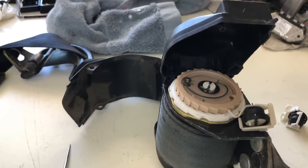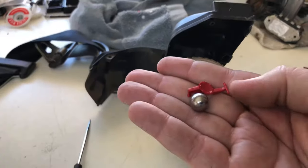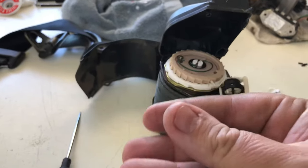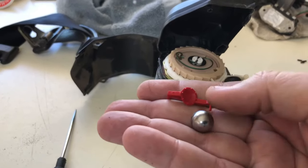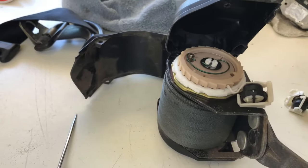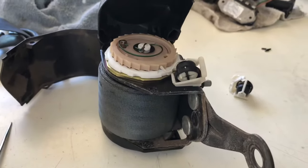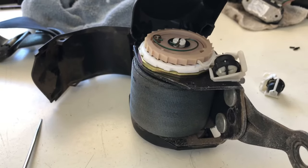The designs of these things differ from belt to belt. Here's a different one taken from a front seat belt — that ball bearing isn't sitting in the right spot, it just locks into place. So just be conscious of this when you're pulling it apart. Be nice and gentle, take your time, because you don't want something flying off and not knowing how it was sitting in there.